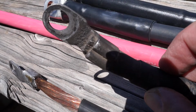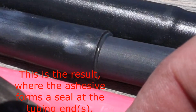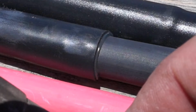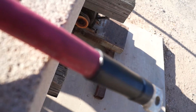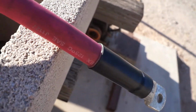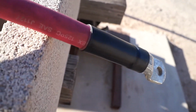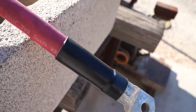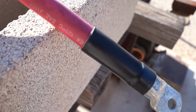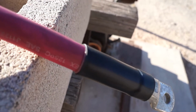I want to say, there comes a point here where it's a little easier to talk over the video. Yes, this is an explanation of what the adhesive looks like when it's all melted and the tubing has shrunk down. This next video clip, the audio was less than mediocre, but it does give you a better representation, two colors contrasting, of what that adhesive actually does. It provides a water or weather tight, weather resistant connection, especially if you're doing boat trailers or someplace or connection that will see a lot of moisture. Just something better to do now than to have to redo it later.